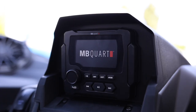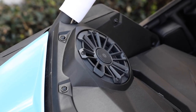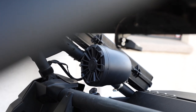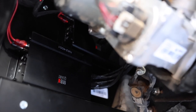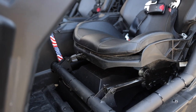Let's take a look at the placements. The head unit mounts to the top of the dash and comes with the kit. The front stage consists of replacement dash panels with the speakers already attached. The rear speakers are in pods that mount to the roll cage. The amps are installed under the dash on the driver's side, attached to the provided amp mounting plate. The woofer boxes go underneath the seats.